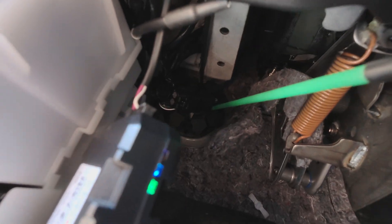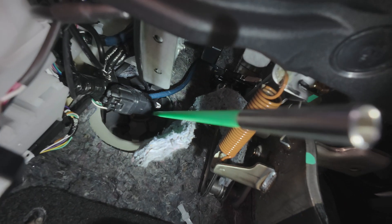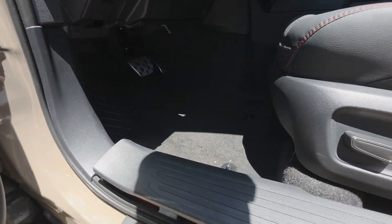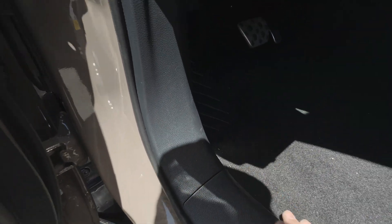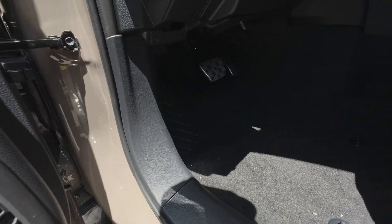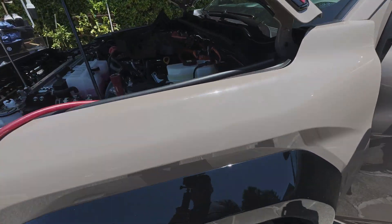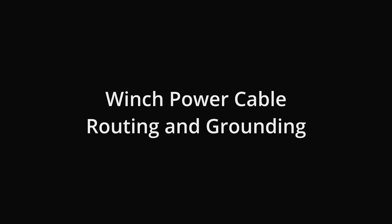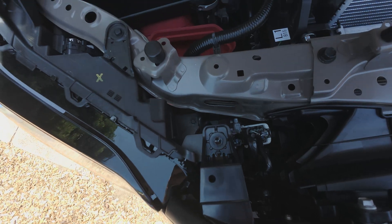It's through — you guys see that? I'm going to pull the red cable through now. I had to take this panel off — there's just a single screw back there. Feed it up and you can see the red cable in there. This panel just pops right back on, and the wire is coming out the firewall right there through that grommet.